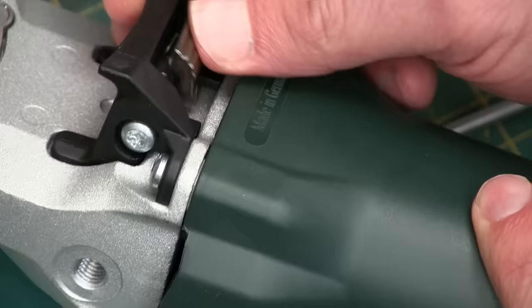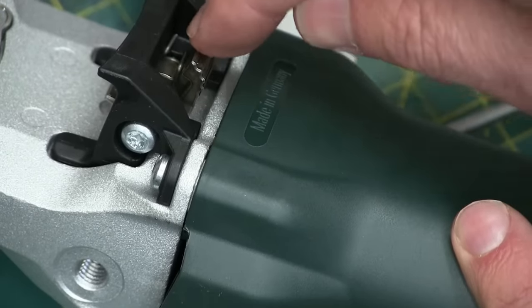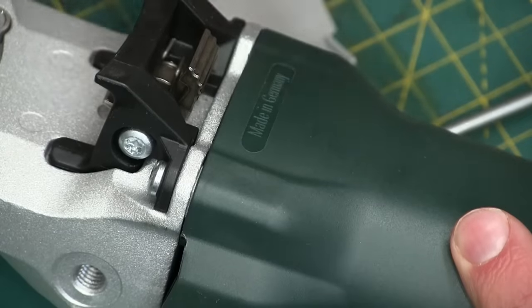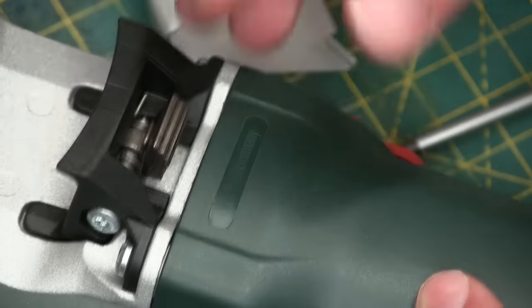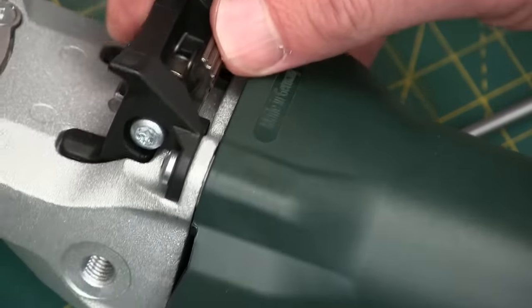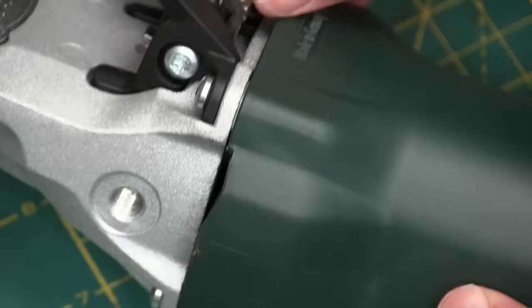You wouldn't be able to cast it in steel because the processing afterwards would be so expensive. But the detent on that is so heavy — this is sintered powder metal. They take a powder of different types of metal — mainly steel, but some copper and all sorts of stuff — put it in a mold, squeeze it, and then cook it, but they don't actually melt it. They cook it at a high enough temperature for long enough that the grains grow together. Powdered metal gear has revolutionized how complex and cheap we can make parts like this. In this application, it'll last longer than you.